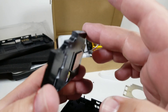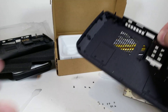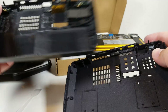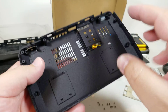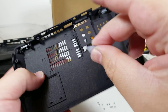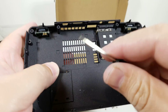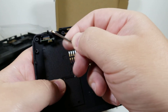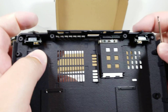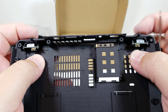Now that the first part of the mess is done and completed, we have this TIM sandwich going on. At this point it's a good idea to go ahead and start removing these pieces — the shoulder button pieces — from your old case to apply to the new case. This obviously only applies if you have the new nylon case. Additionally, look for these little plastic pieces if they fall out and they're in the bag. Just like that it comes out. What I like to do on the other side is use the flathead screwdriver to pull it out. This is PCB, so don't worry about it being a little bit stiff — just go ahead and pull it out and then put them back in. Make sure you put that little plastic piece over the little lip and you're fine. It's really, really straightforward and easy.